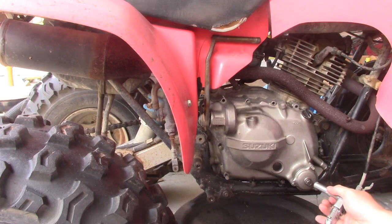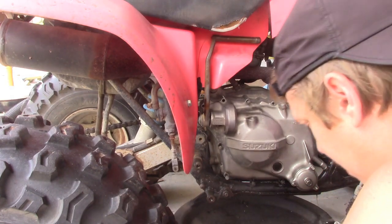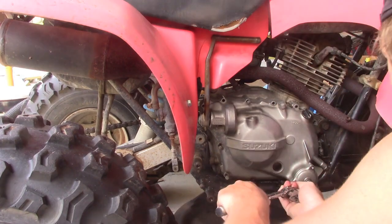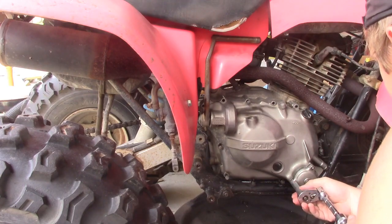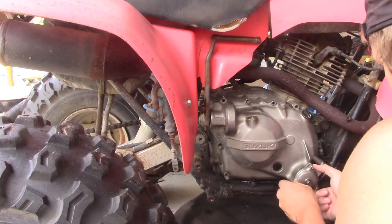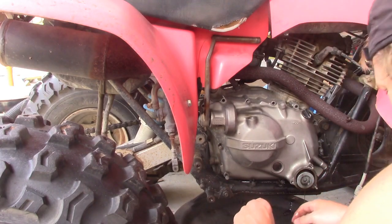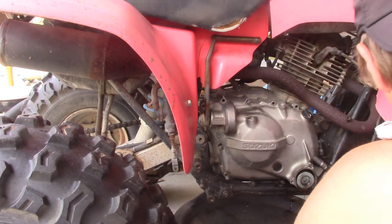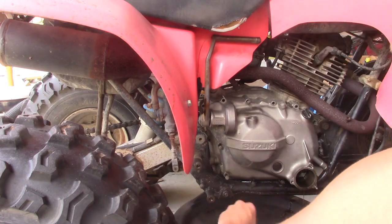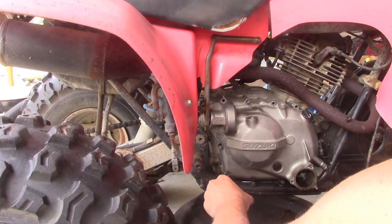Nothing else I can see down there that would be holding it except these three. Definitely some kind of spring in there. Oh, oil filter. All that ringing is just the damn oil filter. Okay. Guess I've worked on too many automatic transmissions where unbolting something like that can screw half the engine. Ah, and there's my hidden bolt. Since I don't have another oil filter on me right now, I'll make sure to protect this guy real good.